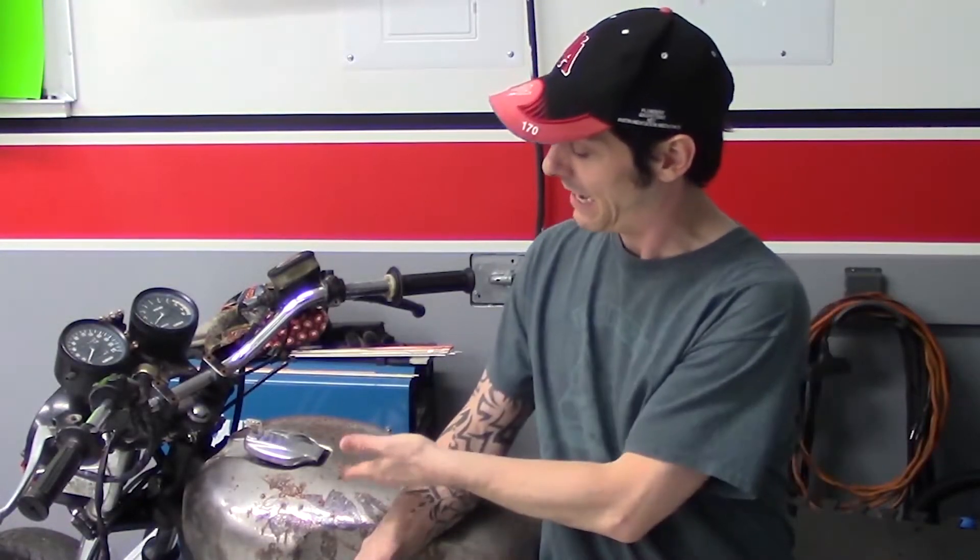When Quarantina was dropped off, Frank had mentioned that the gas tank had a failed coating. It's very common for these old tanks to have a DIY epoxy liner, and this is no exception. Unfortunately, even when you do all the prep work right, sometimes the coating just doesn't last, and all this junk has got to get cleaned out. After filling the tank with acetone and leaving it sit for a few days, I was actually able to get a lot of the old coating out — probably enough for a test fire. The good news is that most radiator shops can do a caustic dip that will chemically strip everything off the inside of the tank; the bad news is that it'll strip everything off the outside too, so it's not the right solution if you're not planning on repainting later.